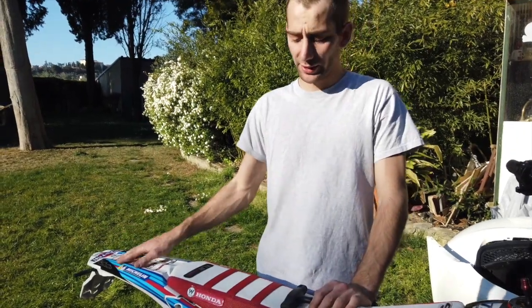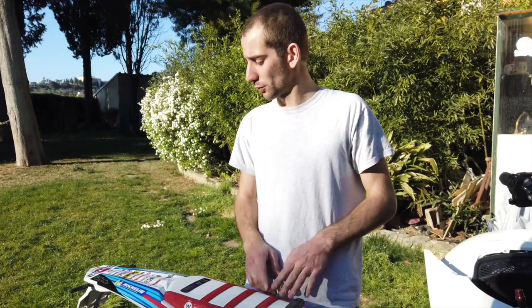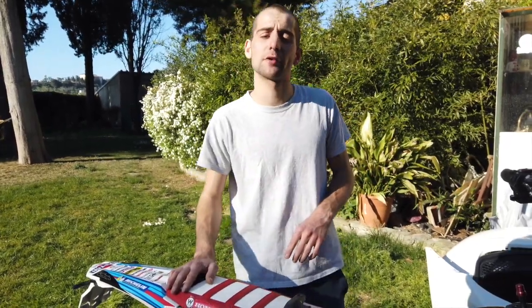Alright guys, so we fit back together headlight and tail light, and we went ahead and inspected the air filter since we were there. We also checked the battery voltage, everything looks good. So right now we're actually going to start it, let it heat up for a little bit, and then we'll go ahead and do a full oil change on it. We'll even inspect the oil filter, just to be sure, being that this is a brand new bike, we don't want anything going wrong on it.